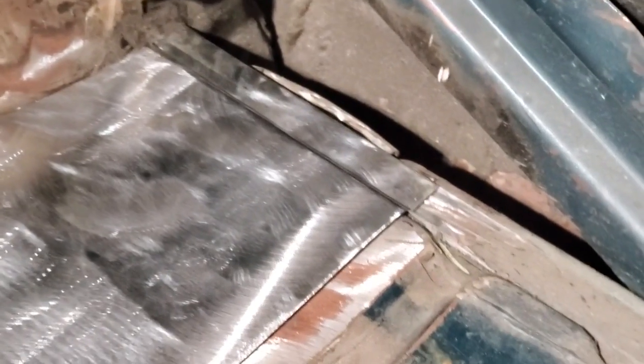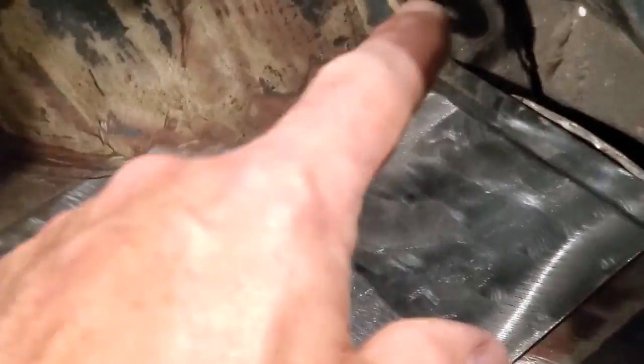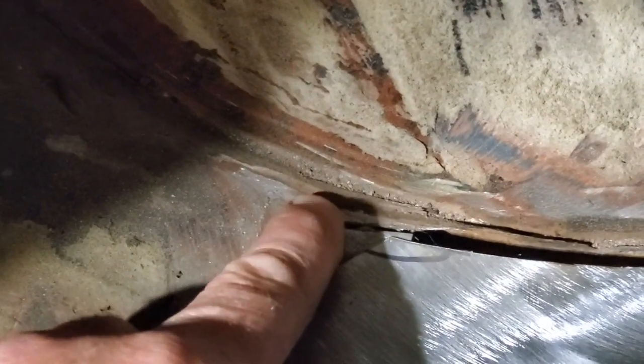As you can see, there it is, fit in place, and you can see the rolled edge. I went and softened up that little roll a small bit. Now what I got to work on is this up here. Now the thing with this is it's not a sharp edge on the thing. If you look closely here, you can see this got a roll to it. It rolls down around the panel. The roll is back about a quarter of an inch off of this here. So I'm going to put a roll on this first before I put a downward lip on it. The lip is straight up and down, so that shouldn't be an issue.